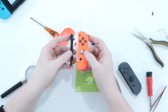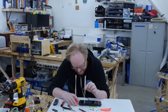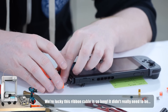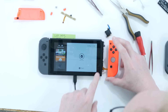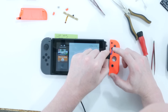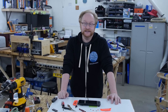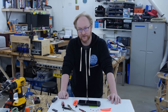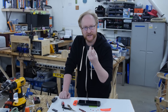We could extend the cable out a little bit — I think you could almost get away with it like this. I don't have to rewire that cable, it's got enough slack. Just barely would fit, and that would make it a lot easier to play. All we would have to 3D print is a spacer interface between the two sides with a spot for the joystick. And then the only thing we need to rewire are the five connections on the joystick, which would be a lot easier than rewiring the ten-pin connection. That makes this mostly a design challenge.